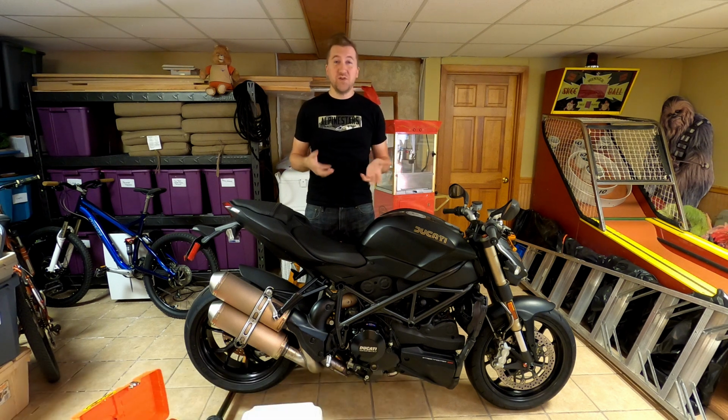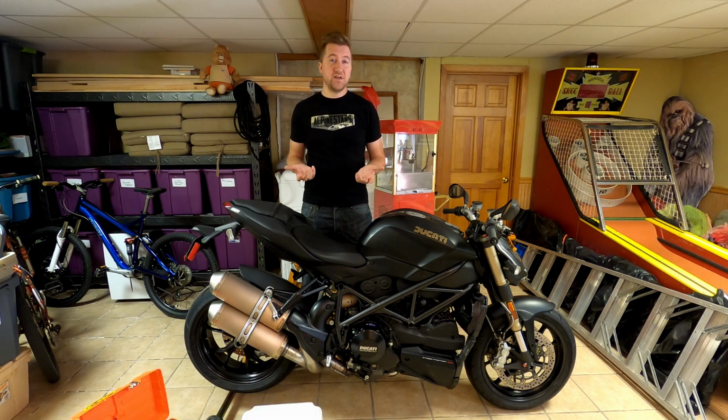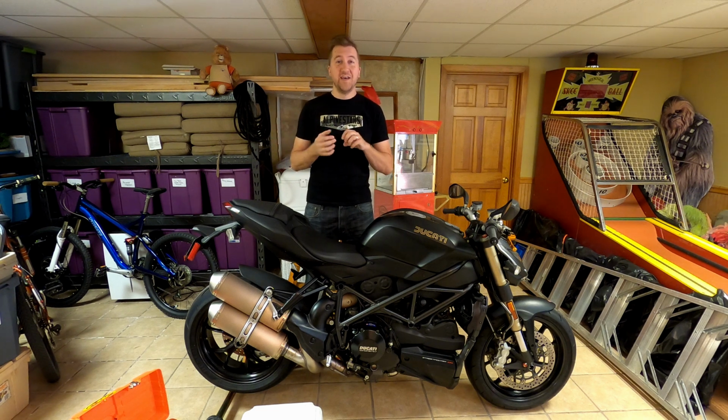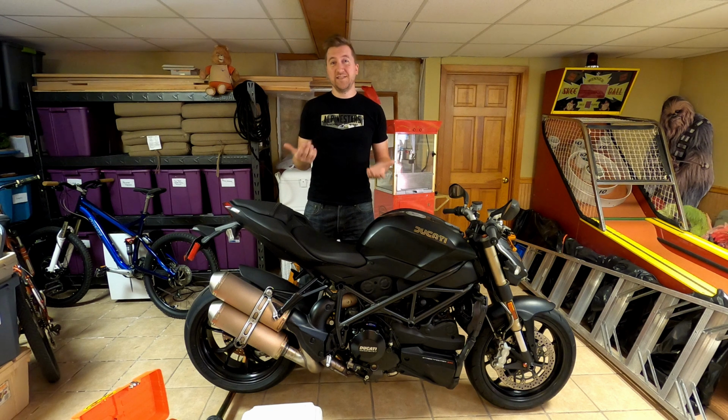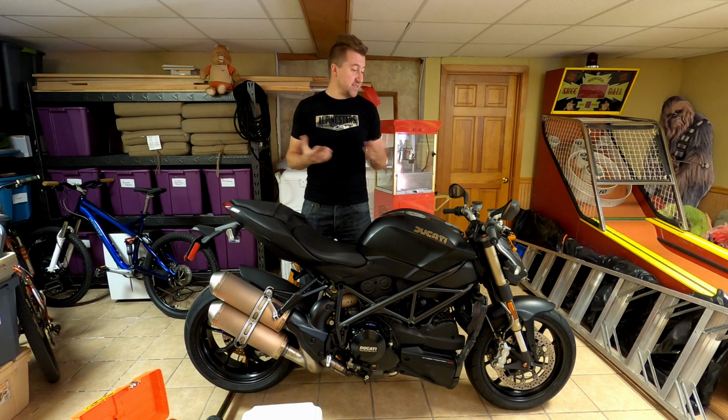If you have a glass one, which might be more typical on an older motorcycle, they ask you to put tape over it. And that's so if you get in a crash and the glass actually fractures, you don't have shards of glass going everywhere. It kind of keeps things contained. Plastic doesn't do that, it doesn't shatter, and the pieces are not dangerous, they're not super sharp. So that's the first thing that they check.